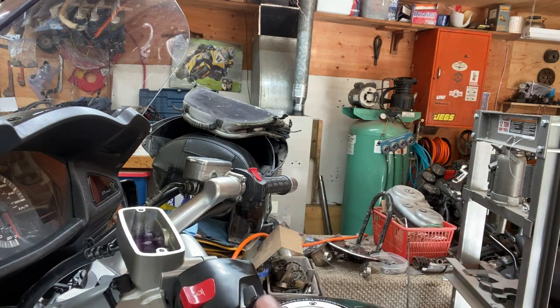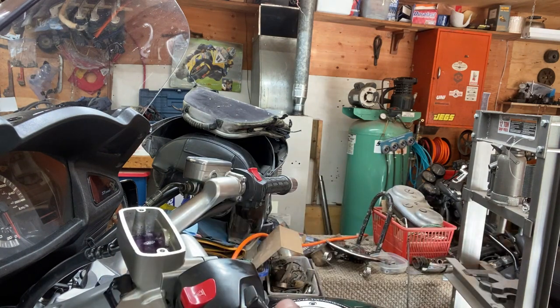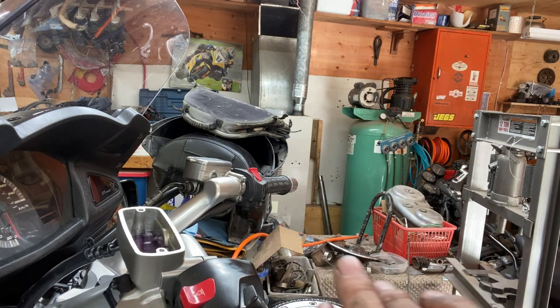When I did the Yamaha Venture a couple weeks ago, I bled it all, no bubbles, no foam coming out, nothing. And then I drove it for about 100 miles. And by the time I got back, I could feel that it was getting just a little mushy. And then I bled it one more time, a big bubble came out, and it's been perfect ever since. There's a big bubble there.